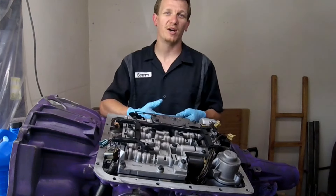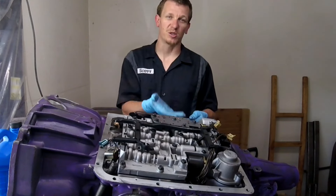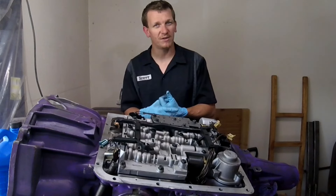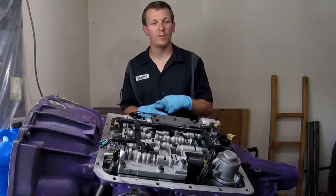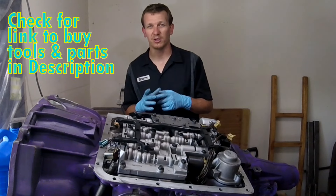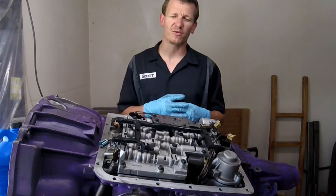This is a pretty simple repair and check. You do have another accumulator on the other side of your valve body separator plate, on the transmission side — check my other videos for that. If you do need parts to repair this problem, I'll have links in the description below to buy those parts. You can do the Sonnax pinless one-two accumulator and three-four accumulator pinless valves.